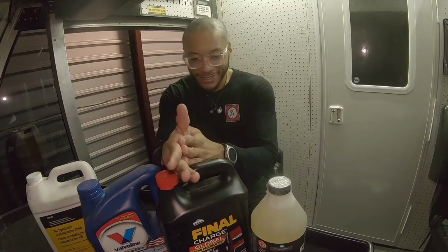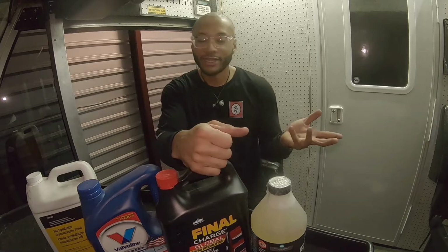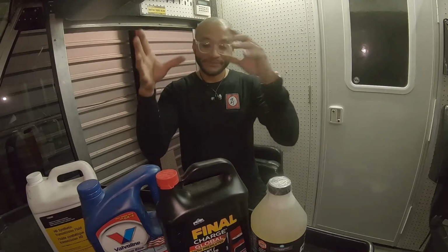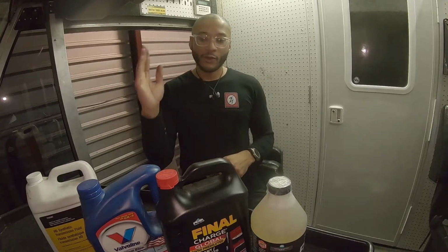We're gonna do our coolant, but we have to bleed the air out of that. So I'm gonna show you how to do that. You can just turn your heat to high, put it on blast. If you can, get your reservoir at the highest point. Just let it run, just let it bleed off. And oil, prime your oil filter.